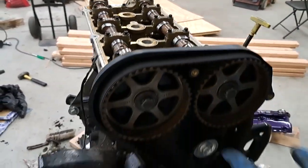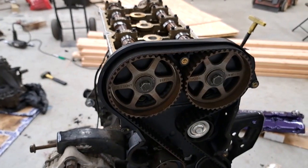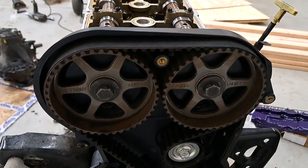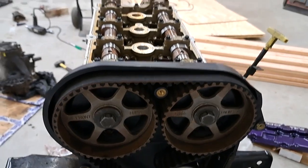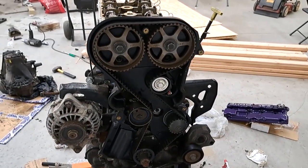If you have adjustable cam gears you can get them really exactly straight up, but I was using regular cam gears. The cams I use in this car are Crane 18 cams and they are 2.0 cams, so the one intake cam is flipped. To use 2.0 cams you'd have to flip your magnet too to get it to work, but it's the same timing in a 2.4 and a 2.0. Thanks for watching.